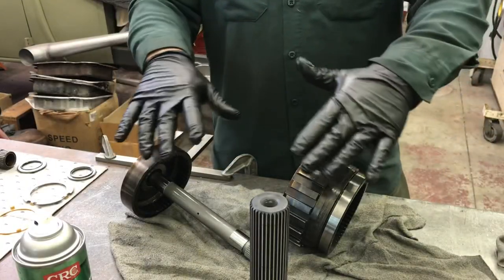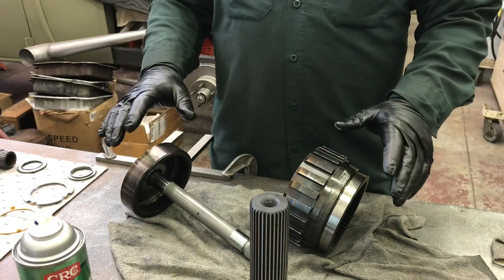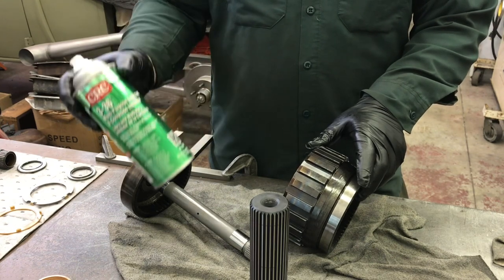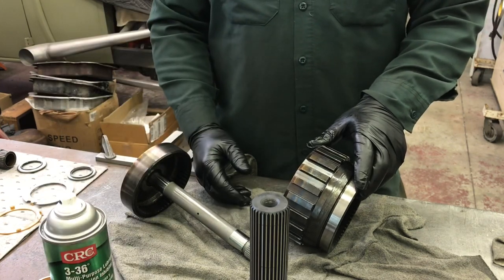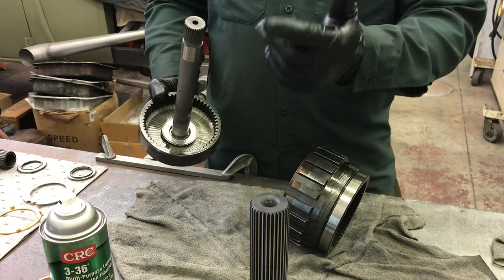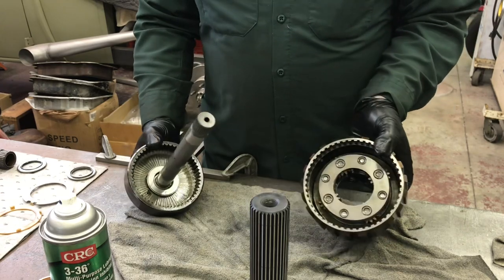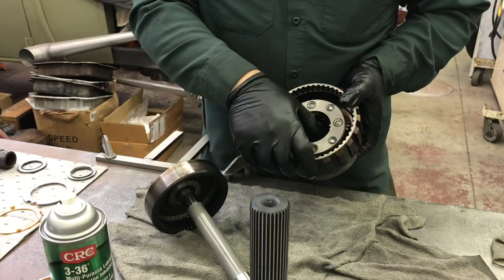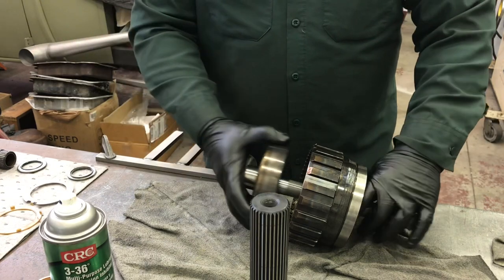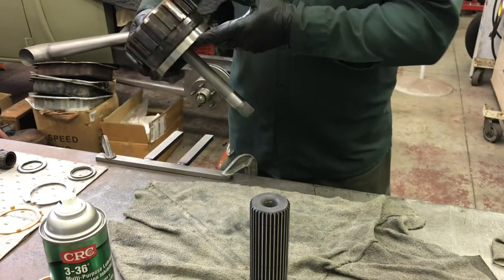Live action now. I've cleaned all the oil off the metal during cleaning, so before I assemble anything I spray it with rust preventative — I don't know how long this transmission will sit before I put oil in it. I've assembled the first bearing over the main shaft next to the ring gear. This goes through the output carrier and can only go one way because the teeth need to go over the planets. Holding it horizontally so the bearing doesn't fall out, I give it a little spin and it drops in. Now I can take it as one piece and put it in my bench fixture.